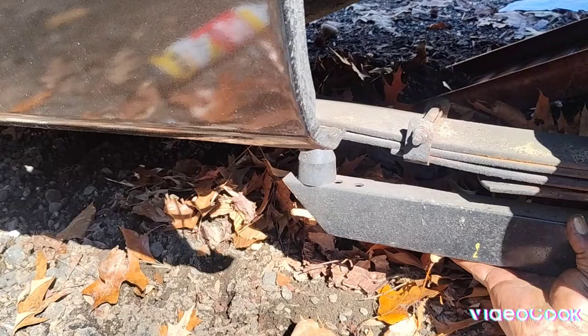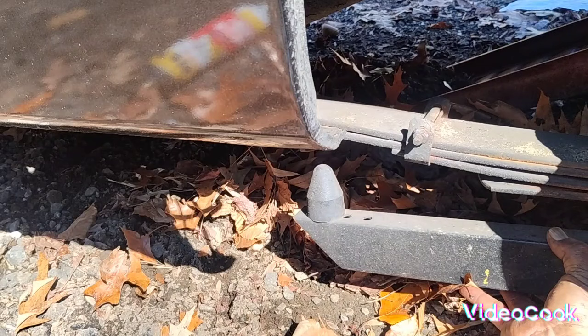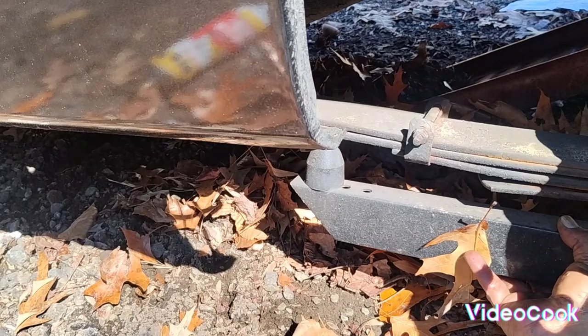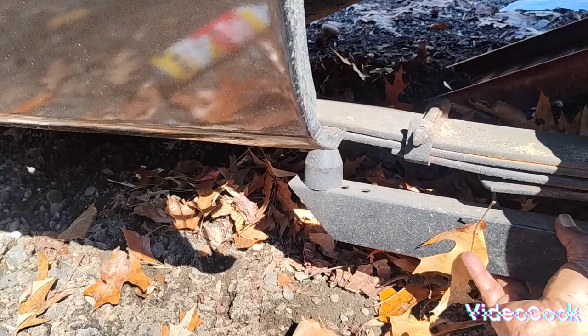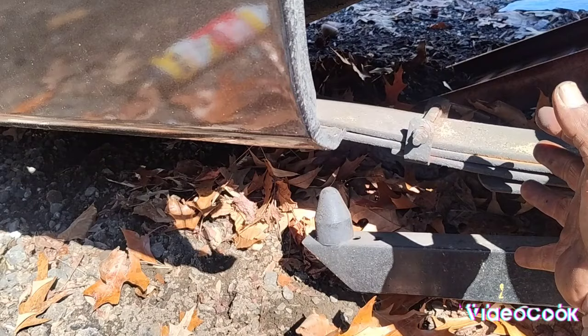Being that my tires were blowing off, it would actually sit like this, and when I launch, it smacked this, which in turn made my tires break loose. So on motor or on nitrous, I was getting a bind. It was slapping it, giving me a bind in the spring, making my tires blow off from a dead hook to blowing them off and then back into a hook.